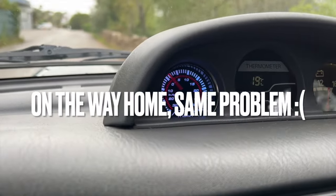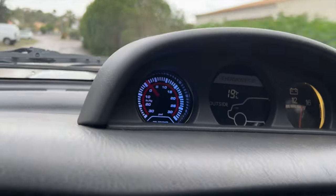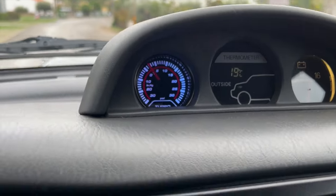All right guys, we've encountered a problem — it's sticking at 20 again, that's far too high. The L200 is still over-boosting. I drove it all over the mountain flat out, in and out of gears — no problem, it went to 15 and came back down. But as I was coming back I turned the engine off, filmed an outro saying it was fixed, then turned it back on and when it's hot it over-boosts. So if anyone could let me know what you think it could be in the comments that would be massively appreciated. I've got one sensor to try and change and I'm going to change some more boost pipes, but I don't think it's those. Please like, comment and subscribe.